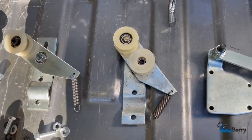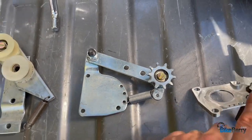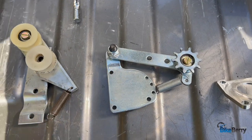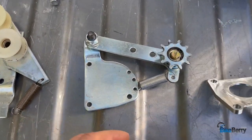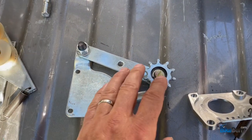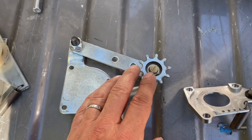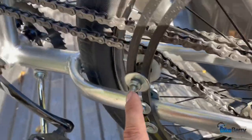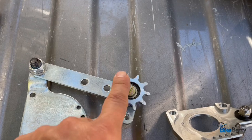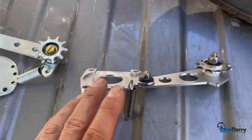The improvement with the double pulley option was much better — the chain rides on one pulley while the other does the tensioning. I really love this one; it did the job phenomenally. These are all ones that are mounted and look rough and rugged, but a lot of people paint them to match their ride. The case-mounted spring tensioner worked really well — it doesn't look as good as the billet, but the spacing was proper and it was easy to put on. It functioned flawlessly. One thing to note: on rough terrain the chain could hop off the sprocket, and if you put too much tension on it, it'll pull the sprocket off the bearing — it's not meant for tight tension.